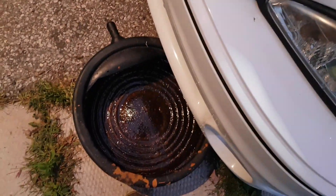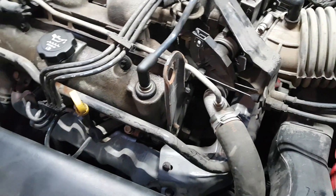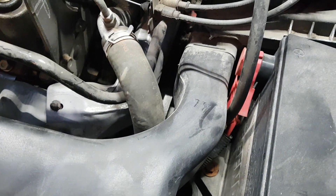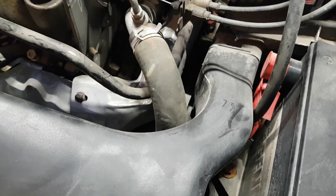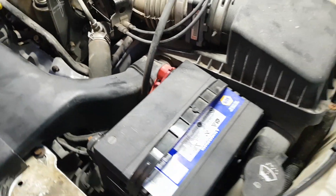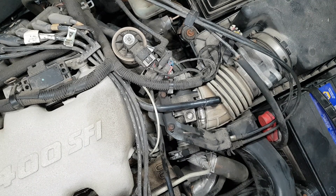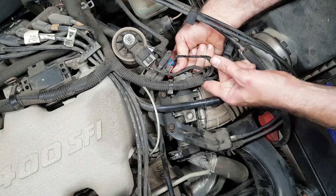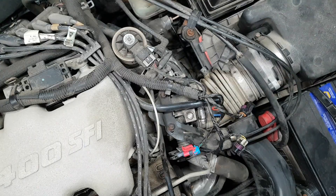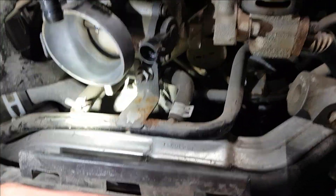The engine's cooled down quite a bit now. I got my bucket here to catch some coolant. First things first, start by getting the air box out of the way and then the air intake tube. But before that, if you don't feel comfortable, start by disconnecting the battery. I don't usually, so I'm just going to leave that connected since I'm not really doing any big electrical work, so I should be okay.